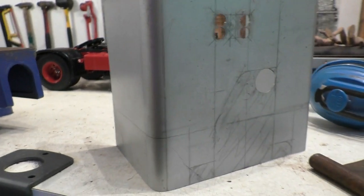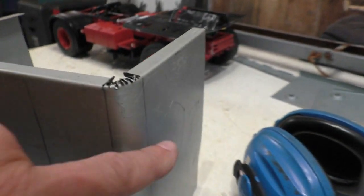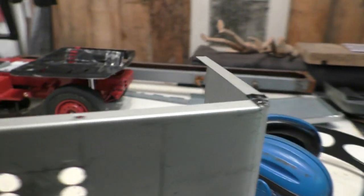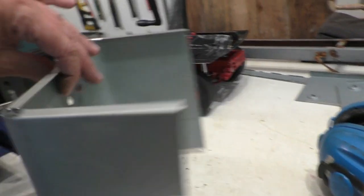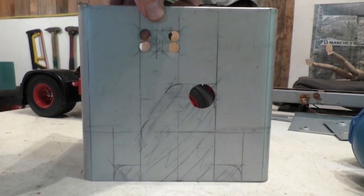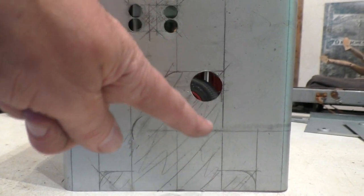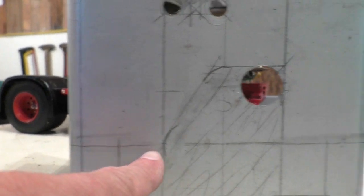So there's the rear of the cab - those are all those slices I did there. I might have to beat on this to get the roll a bit nicer but it's within range now. It looks a bit weird at that bend there, but other than that it should be getting pretty close. It's almost bang on. A bit of finessing and that'll be good. Then I can cut this stuff out the back here and it should slip straight down over the chassis.